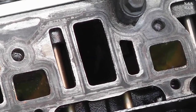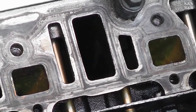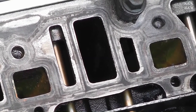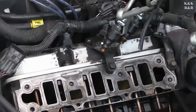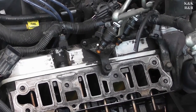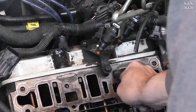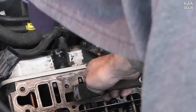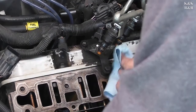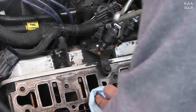I'm just going through to show you how clean it is. We have a little bit of area to work right there. I'm going to do the finish touch on this one because unfortunately my son is still a young technician and I prefer to do the final — that's just the way we do it around here. I'm going to show you what tools are safe to use: good old putty knife. After you're done scraping, take some good old brake cleaner and clean it.